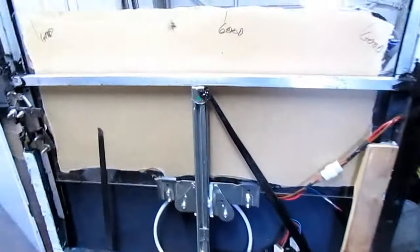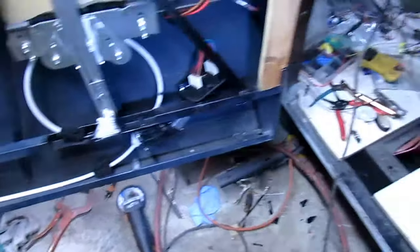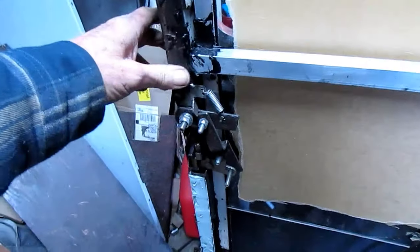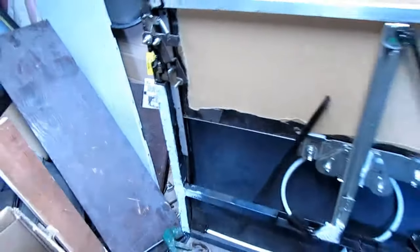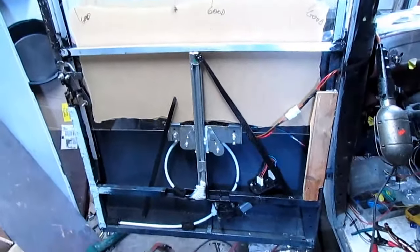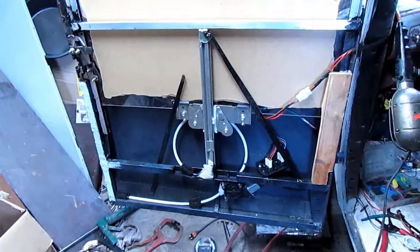Well, I got a little work to do here. The window and everything's going up and down good. I need to put this brace on it here. I have to mount this motor to where it's going to clear the door panel, and I'm going to have to cut some of this stuff off here to make sure the panel will fit. I need to grind a little bondo off here. So basically, I've got a little trimming to do and bracing to do so I can get this window finally mounted. I'm going to try to set this up on a tripod and get you a little action video.